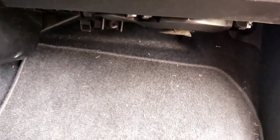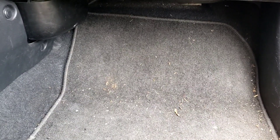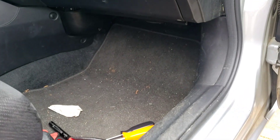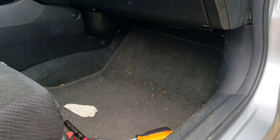Okay, quiet — back to normal. That's what that is. Now of course, if I was running my own shop, you need to pay the bills — people are going to sell you a blower motor because nobody's going to go through all this trouble and put back the old one just to clean out a little piece of paper. Unfortunately, that's the way things are because the mechanic, the owner, and the shop all need to get paid. But listen — it's three screws, two screws for the cover, pull it down, there's a little debris, we found it, we solved it. Thanks for watching, guys. Ciao.